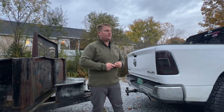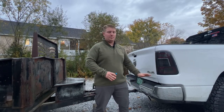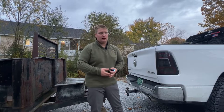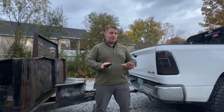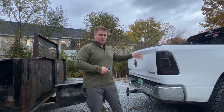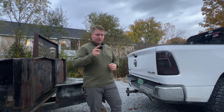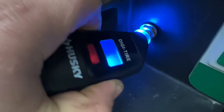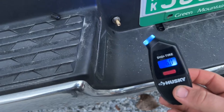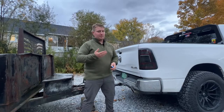It's been probably three to almost four months since I did the install portion of the video. I've been driving all summer on these bags. I put 10 PSI in them and took a reading about a month after, giving them a chance to break in - it went to about seven. I left it and didn't add any more. I've been towing a bass boat, utility trailer with my ATV, loading it with tools and material. It rides a lot better and doesn't squat as much. Checking it now, we're sitting at six PSI, so we've lost one PSI in about two and a half to three months - and temperatures are getting colder, so air contracts a bit. Losing only one PSI is pretty good; these things are definitely holding air.